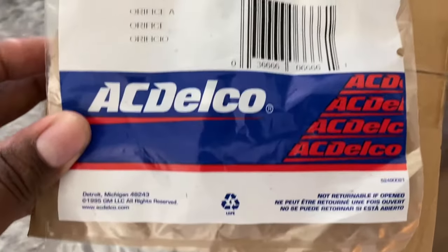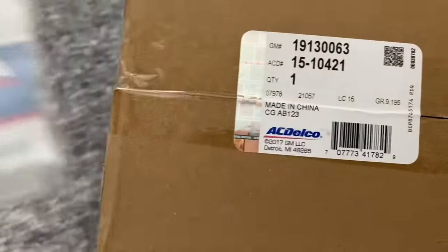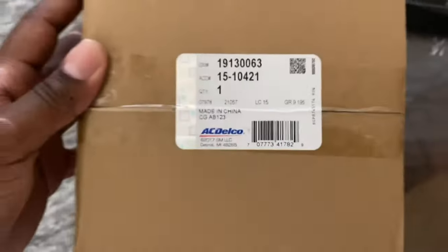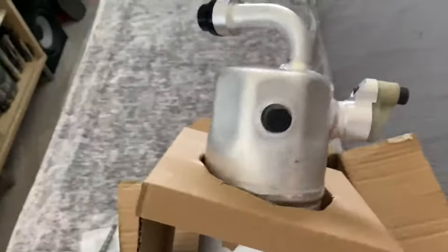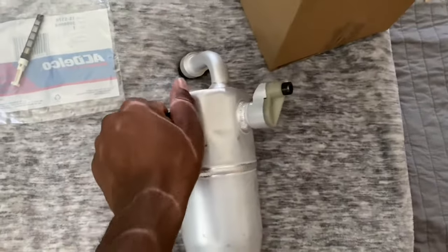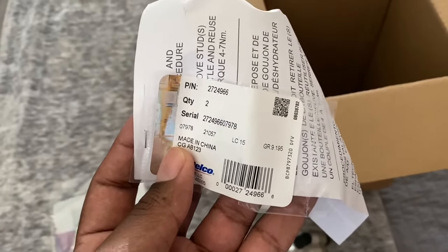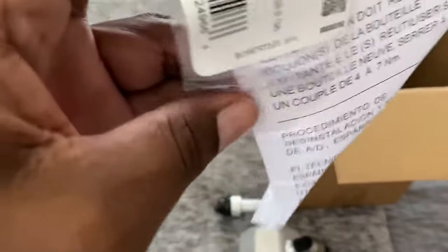Since I'm already working on those lines and it's going to be empty, I'm going to replace the orifice tube as well. Here's the one I bought. I ordered the wrong accumulator the first time — apparently there's two different styles: one that has the stud on top and one that has the stud to the side. The only difference is the last number on those two parts, so make sure you check which one you have on your car before you order. It comes with two washer seals, and there's a little note letting you know that you have to take the stud off your old accumulator and put it into the new one. I'll be putting a link in the description for every part I bought, including the wrong part.